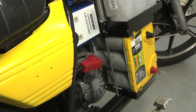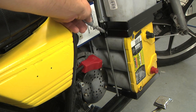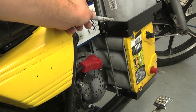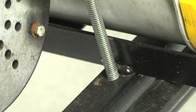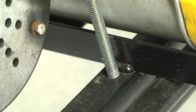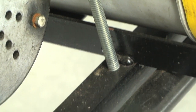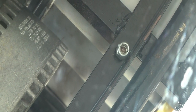From the back we can see a couple more things — these middle two brackets both have a little piece of pipe welded on for the threaded rod to go through, with a nut that compresses down to hold the bottom battery in place. The bottom bracket is welded to the side rail, and the threaded rod goes through a hole there. Pointing down at the mirror underneath, you can see there's a nylock nut on the bottom that holds it in place as well.